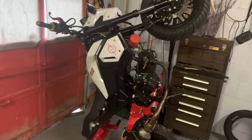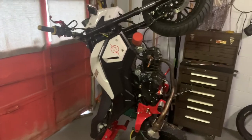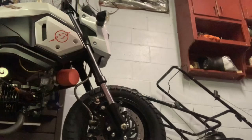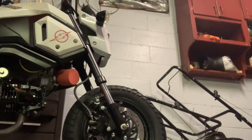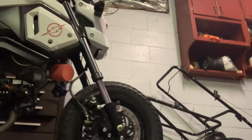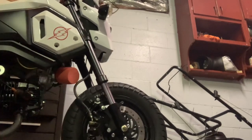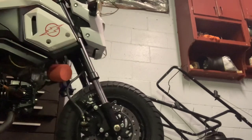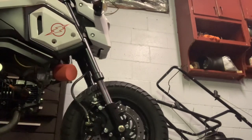But the forks — I should have showed y'all a video of the before and after with these forks. So this is what the forks are like before doing any kind of mod. I naturally sit on the bike and I've already picked it up some. If I hit the front brake, I hear the fluid and it bogs out heavy. The bike really doesn't come back up until I pull it back up.